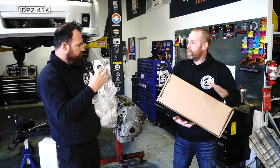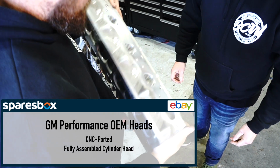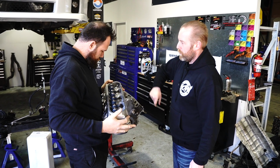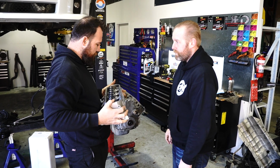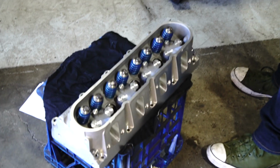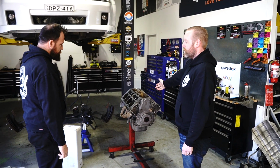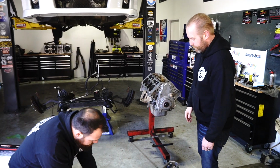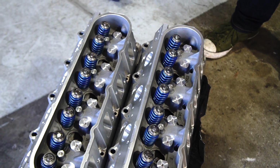Should send these to Shaquille O'Neal so he can put his shoes away. One shoe. Yeah, that is quite the cylinder head, Ian. This way, you don't have to wait for your heads to be machined and cleaned and hot tanked and stuff. You've already got valve springs that are not going to wilt under the awesome raw thumping power of your upgraded camshaft. New seals, and it's all brand new too. There's no mess, no fuss. Second hand, no remanufacture, which is also fine, but at least you know where you're at. You don't know what the history of this ute has been. It might have split a radiator and tank 10 years ago and overheated this engine to 110 four times. Yeah, and the heater and the cylinder head cores are no good. Well, I have seen that before. It's unfortunate, but it does happen. 320 cubic feet of air a minute. So they rated up. Yep, factory heads.